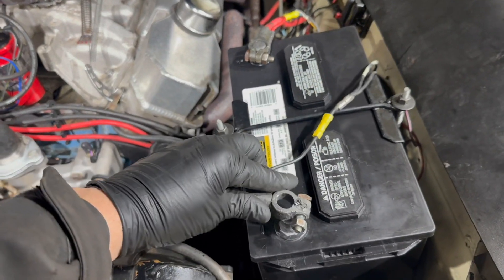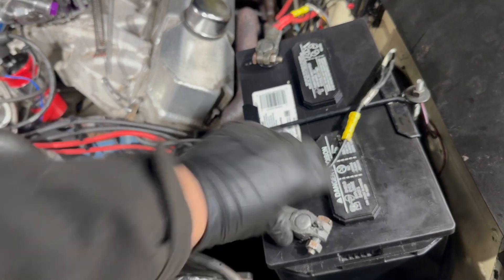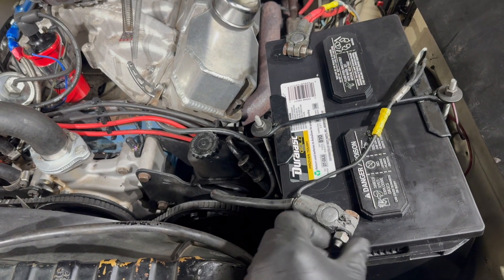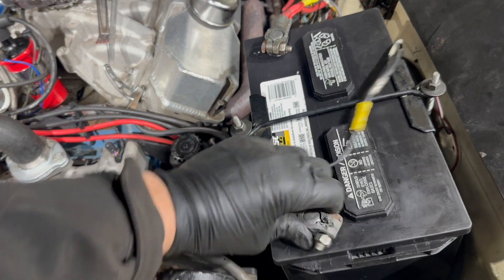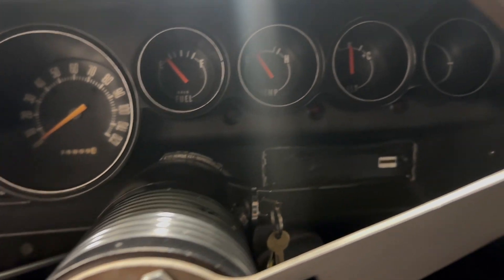There it is in place. Notice I did cover that horrible yellow heat shrink with black tape because it looked terrible. Note that a factory fusible link would have a little tag on it that says 'fusible link' — this does say fusible link in small writing. We could have used a factory-type fusible link for this. Anyway, let's reconnect the battery and make sure this car does not immediately burn to the ground. That arc is the stereo, by the way — generally a car like this wouldn't have anything on battery power, but stereo memory. Note it only does it once, and then the capacitors are charged.